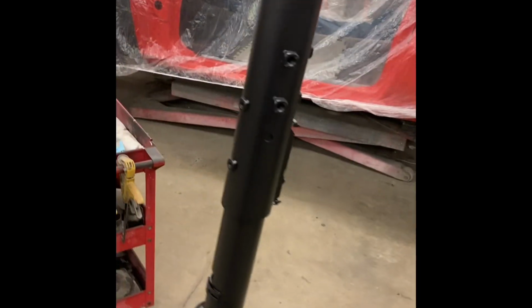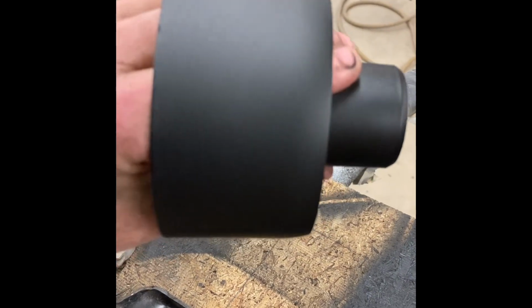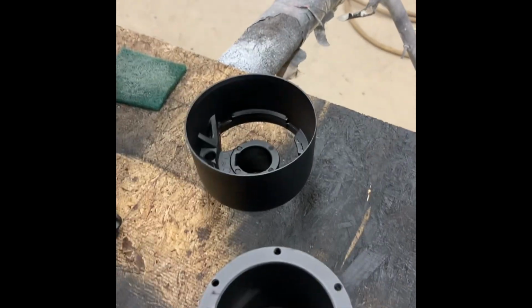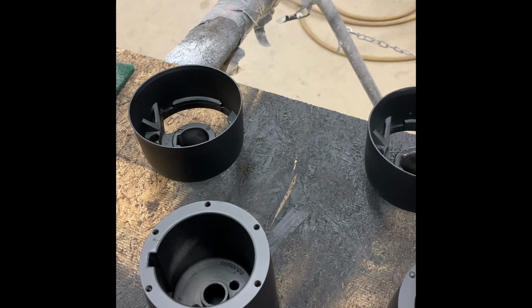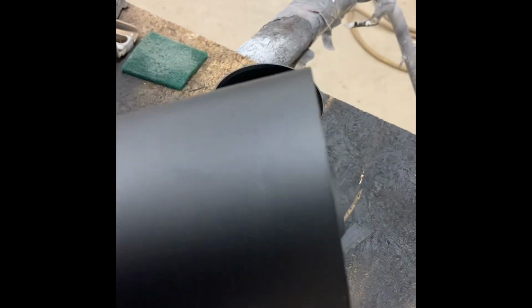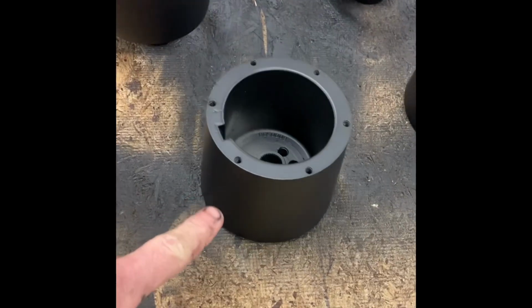So I've got two of them here. I'm actually going to build them both, and I did these pieces. Now that's still the epoxy, but since these show, I'm going to sand those and actually use some trim black. These hubs get a texture to them. So I've got some crinkle paint. I'm going to see how that works. But the reason I went ahead and epoxied is because it sticks to everything, and then everything sticks to it pretty good.